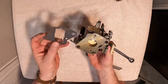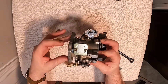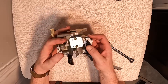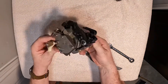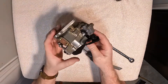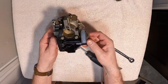There you have it. That last gasket is your intake gasket and that's going to go right here, back onto the studs of the motor, then lock back down. Once it's back on the motor you'll just want to pressure test it — pump the bulb up until you have pressure, test out your prime, make sure you're not having any leaks. It's a pretty easy job if you take your time. Once you get it disassembled you'll want to clean the carb out and dry everything before you do this assembly.